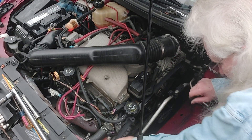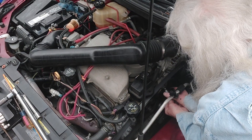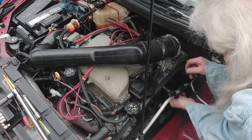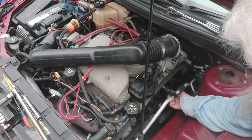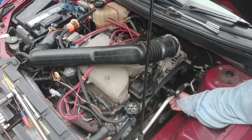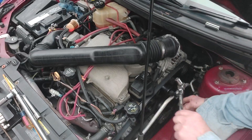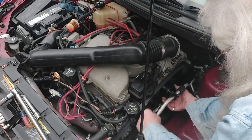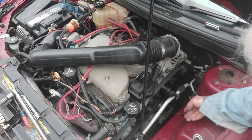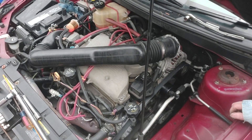The belt goes back into place other than this pulley — everything's good. Just like it should be. As I said, just snug it — spin it, snug it, spin it, snug it. That's aluminum thread so you can't go too crazy. It's probably about the same at 37 foot-pounds. Now the tensioner pulley — bring it on down, get a hold of the belt so it doesn't fall off the other pulleys.